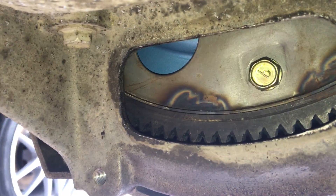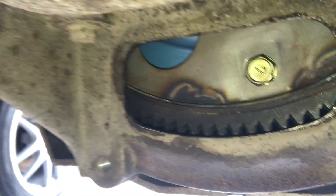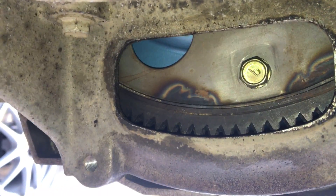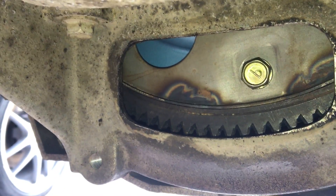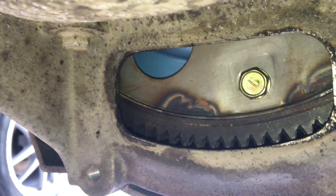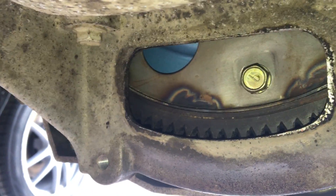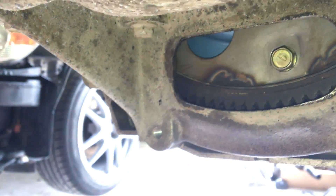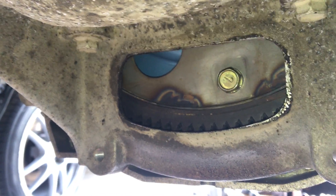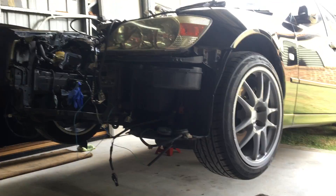Now that I've put the bolts in with the correct orientation, the drive plate is ready to go. I cleaned the bolts with thinners, carby cleaner, or parts cleaner, and I put a little bit of medium-strength Loctite on there — I don't really want to revisit this area again, although it's quite easy with this little plastic opening cover. I'm now putting the engine into the car — this is the IS200 that I'm doing the engine conversion on.